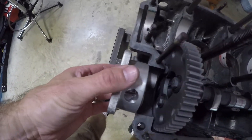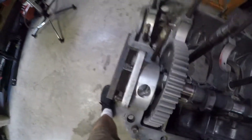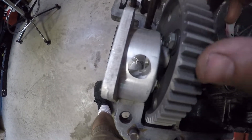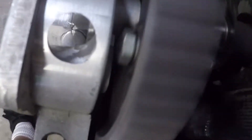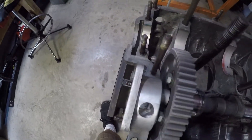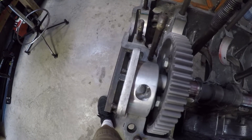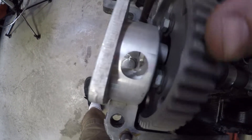The other thing I like to check when doing this — I haven't got the oil pump for this build yet, but it's a good idea to put the oil pump in and make note of where everything's at. I do happen to have a spare old oil pump and you can see I've already done a little grinding on it — apparently it was a pretty tight fit to the cam bolts. Install the oil pump on this half without a gasket, because the gasket gives you a little more clearance, but I want to make sure I have enough clearance. What you look for is those camshaft bolts — make sure they're not hitting the oil pump. They come real close but they're not hitting. Best to put a feeler gauge in there and check for clearance — should have at least 80 thousandths clearance. The camshaft shouldn't move much more than 5 thousandths. It's always best to do the clearancing yourself and not let the engine do it for you.